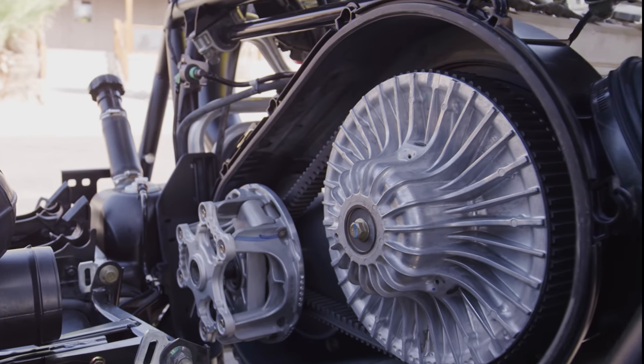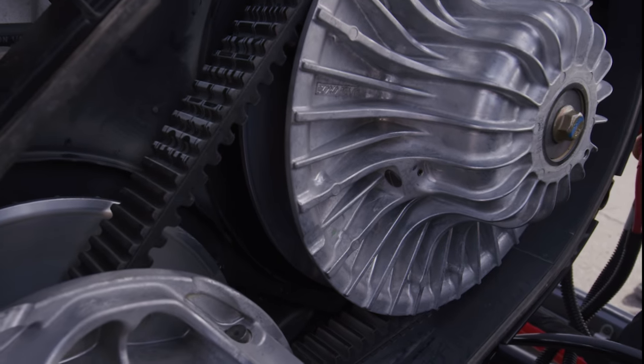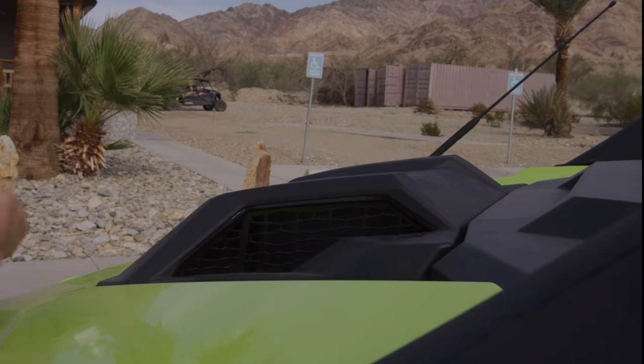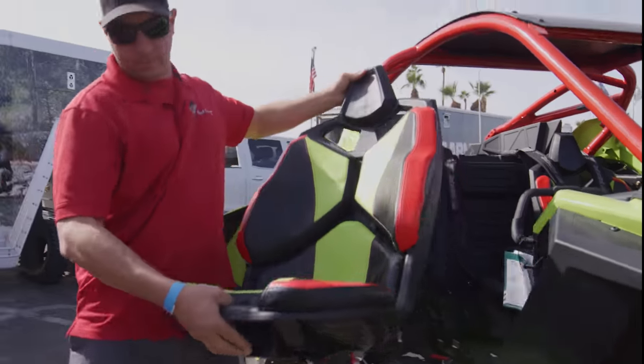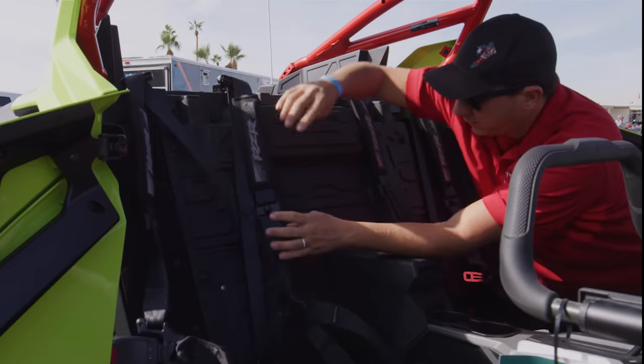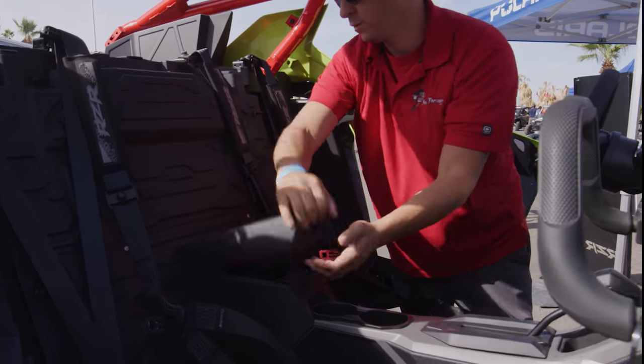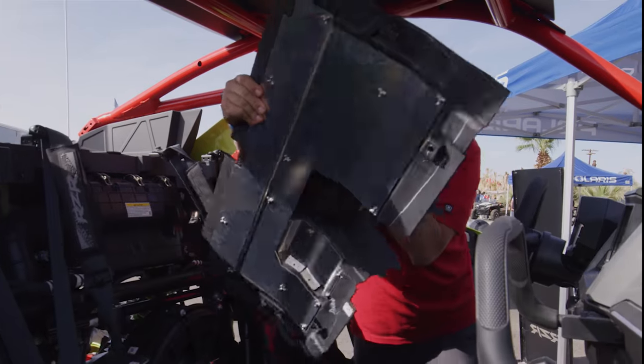There is a new clutch design in the Pro R that is truly state-of-the-art. The clutch centerline is extended to 12 inches, as opposed to 10.5 inches in the past, allowing for a longer belt, a larger belt, and better cooling. The spacing of the clutch off the transmission case has been extended to allow more airflow, which cools the sheave. These clutches are cooled from both the back side and front side through two inlets — one on the rear fender and one underneath the front of the hood — giving maximum airflow and cooling capacity, which translates to a colder belt. The clutch cover has quick-release hardware on the bottom half and 10mm bolts on top, with a molded spot for the clutch tool. Belt changes take less than 15 minutes.